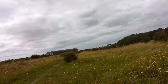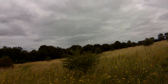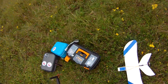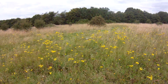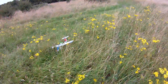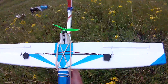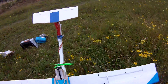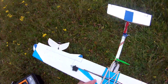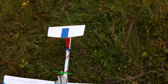That's flat out. Success. Could still do with a little tiny bit more weight, but any more weight on the nose it's just going to be a bit of a counter, because that is just not a powerful enough motor. I think this could do with a 2300. I was tempted to get one for it. No drama. Good job. I would call that a successful maiden test.